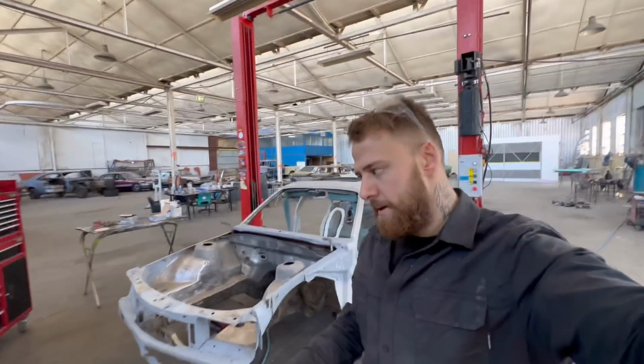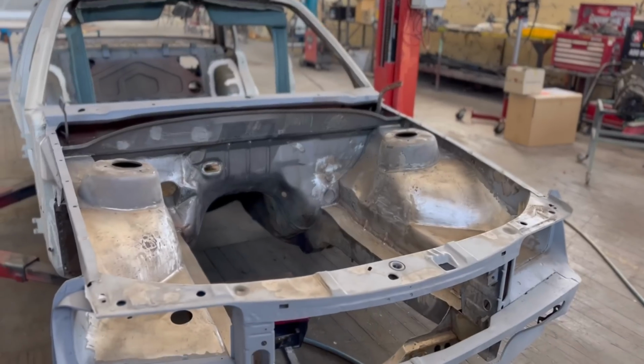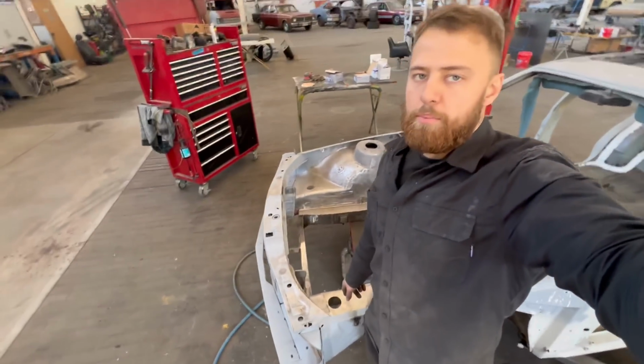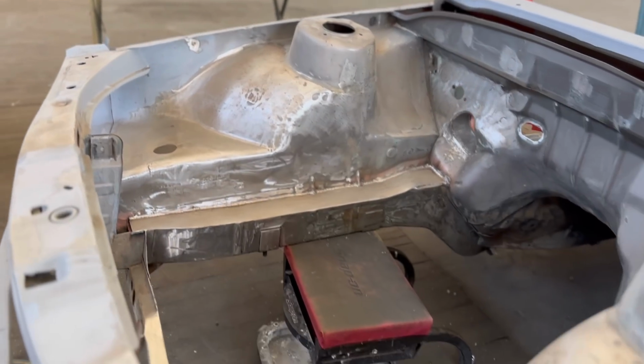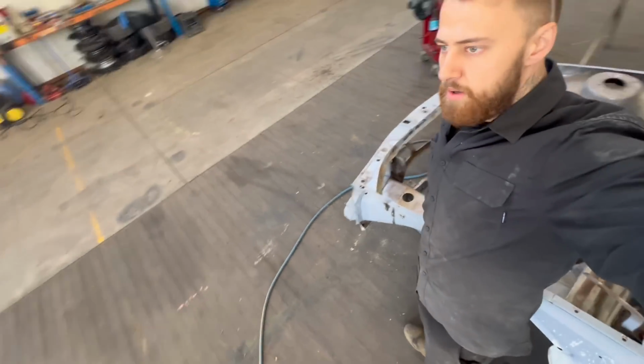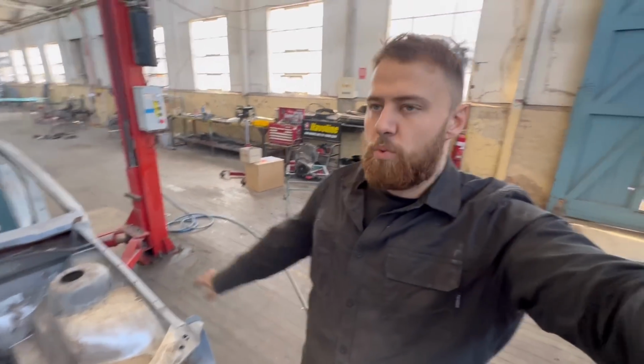Now previously, I've already done all the welding, fabrication, smoothed this bay. It's a VK Commodore. Put the coolant overflow bottle in this skirt, Astra pump on the other side, notched the cross member to fit the FG thermo fan, welded up all the holes.